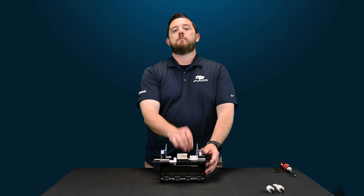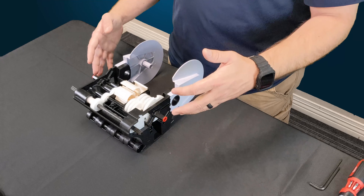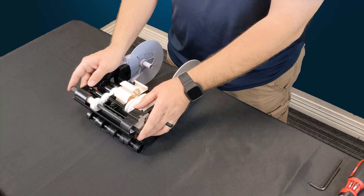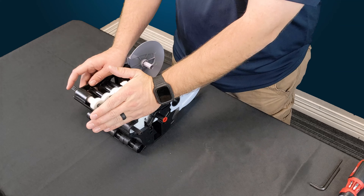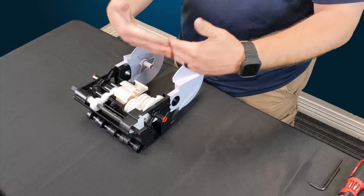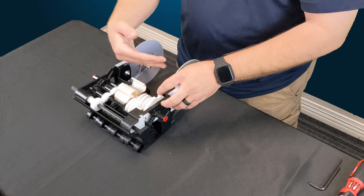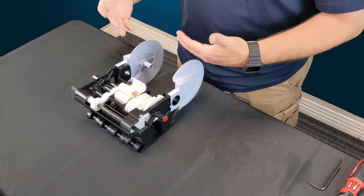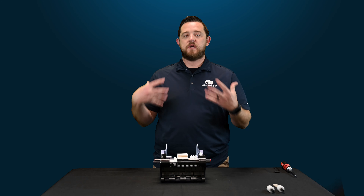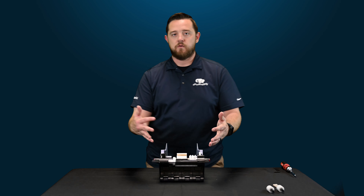For today's video, I want to show you guys how to actually remove the steering bracket. The steering bracket is one of the main brains of this cleaner, aside from the engine which is your vane hub kit. The steering bracket is going to be located on the side where your large cam gear is. As the cleaner's rolling around, this is rotating and driving the cam, which will ultimately allow the cleaner to start changing different directions. So if something's just spinning or if it's not moving at all, definitely start with these front axles, because this is one of your main drivetrains of the cleaner.